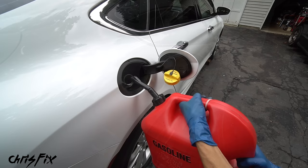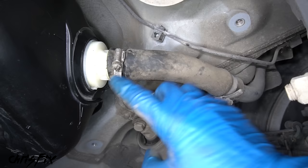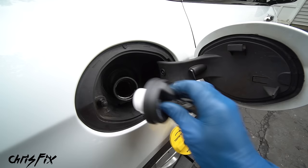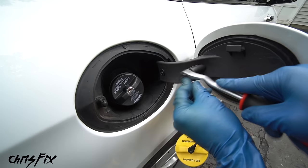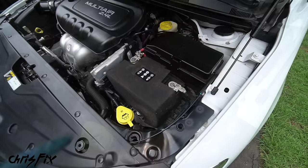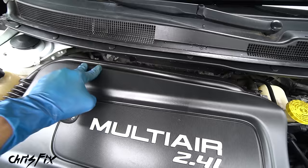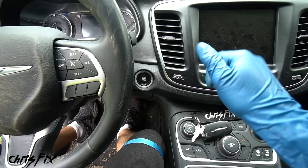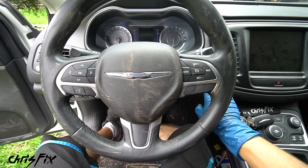Let's go get some fuel in the tank. When you start to add fuel, only add a little first because we need to go under the car and check for leaks. I don't see any leaks at all, so we can add the rest of the gas — about four gallons so we have enough to get the car started and get to the gas station to fill up. Now comes the important part: adding a locking fuel cap, which could have prevented this whole sugar-in-the-tank situation. The old cap pops right off and we're done. Finally, connect the battery — get the ground cable on the post and tighten it down so it's snug. The car is ready to go — I'll leave the hood open because we want to check behind here for any fuel leaks once the car is running.